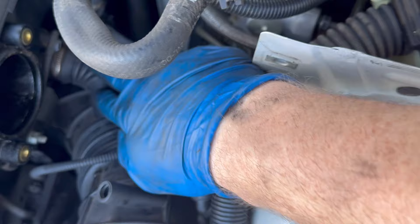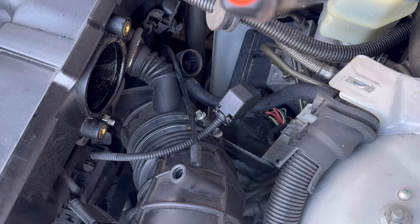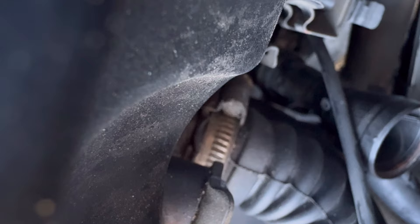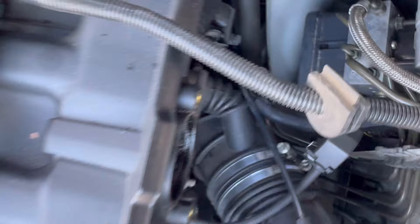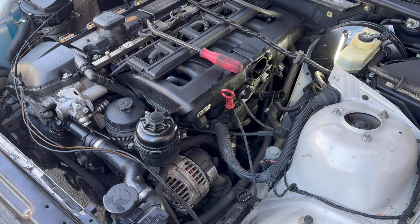We're going to pull the intake hose off. You've got a hose going to the ICV — just a screw clamp here. Once it's out of the way, you can get to the big clamp that goes around the throttle body. As I moved it, this broke off, so we'll have to order that as well — the suction pump. From the factory, the hose clamp is upside down, which makes it a real pain to do in-car. When we put it back together, we'll flip it around. I said I could do this in about an hour — I probably spent 20 minutes just getting those two clamps off.